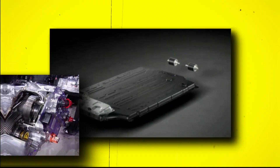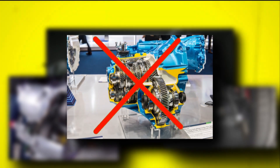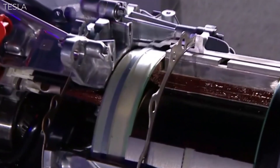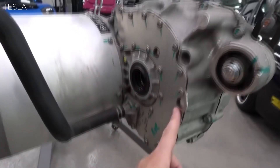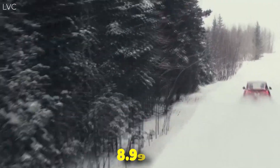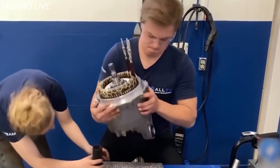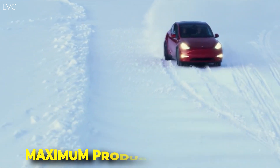The only thing between the Plaid motor and rear wheel is a single gearbox, and that is a requirement. Tesla doesn't have a transmission — there is only one set of gear ratio, but you can't just have the motor directly linked to the wheel; there needs to be a gear reduction first. On the Plaid motor, this is actually a different reduction ratio than on the standard Tesla motor in the Model Y. Munro discovered that the Plaid has a gear ratio of 7.54 to 1, while the Model Y has a gear ratio of 8.996 to 1. It's also intriguing to see that the stator inside the Plaid motor is the exact same component as the one inside the Model 3 and Model Y motor — maximum production efficiency.